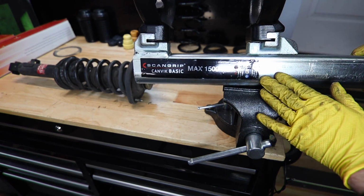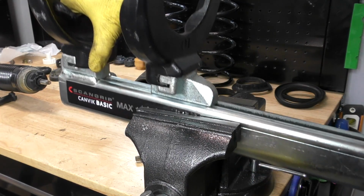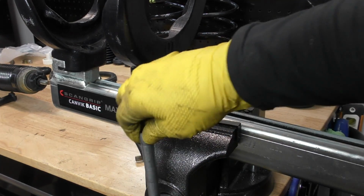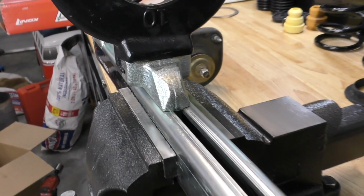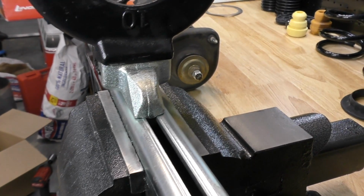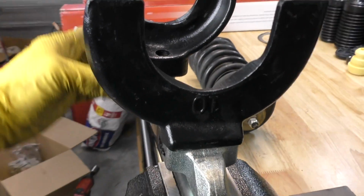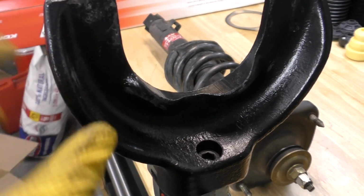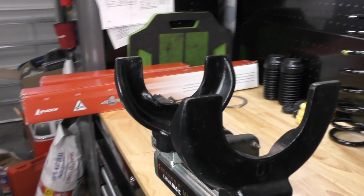For that job, we are going to be using our spring compressor. This one's very similar to the factory Volkswagen tool. And of course, I'll put links to everything that we're using today down in the description. We're going to put this in a vise. You don't have to, but it does make it a little easier. The way this style spring compressor works is by rotating this nut at the end, we can drive the spring seat forward or backwards, tensioning or detensioning it. Inside of here, you can see there's a threaded rod that just moves this piece in and out. The spring will sit in this little cup right here, and there's these ridges that prevent the spring from popping up and hitting you in the face.